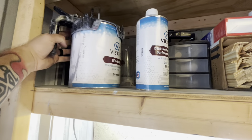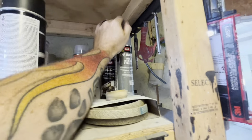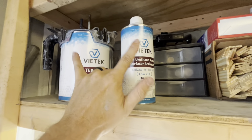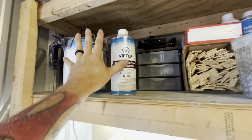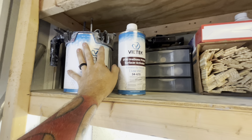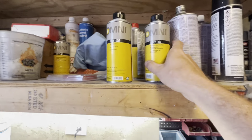To do your body work, you're going to need a 2K primer. Don't waste your money on a 1K primer — a 1K primer is what's in a rattle can. 1K means one part; 2K means two parts, so we have our primer and our actual hardener. If you're on a super low budget, just roll with the 1K, but you're really setting yourself up for not-so-great work. You can buy the 2K primer in a quart to save money. Search my channel, The Paint and Paper Hustle, plus the word primer, and you'll find some pretty helpful videos.